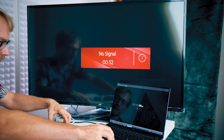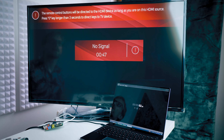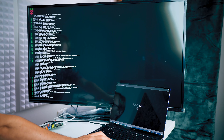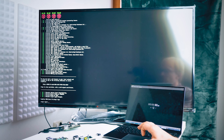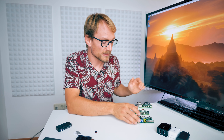For the first performance test, I checked the first thing the Raspberry Pi does: booting up. I measured the time until the login screen was shown. The Raspberry Pi 1 took 55 seconds, the Raspberry Pi 3 took 33 seconds, and the Raspberry Pi 4 took 27 seconds. With the Pi 3 and 4 being so close, I think it's actually the SD card that is becoming the bottleneck. The difference between the Pi 4 and 3 is negligible, while the Pi 1 took twice as long as the Pi 4.